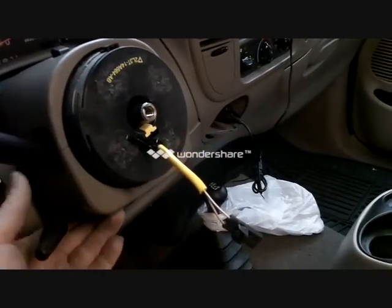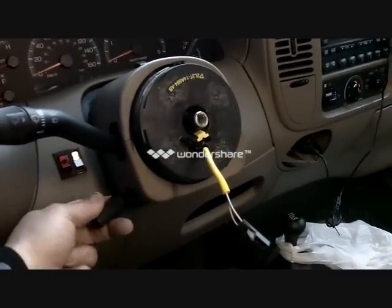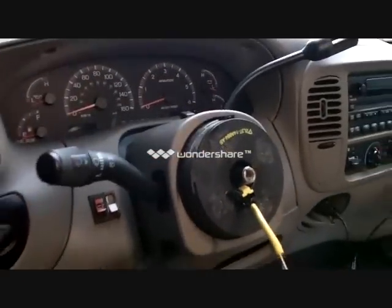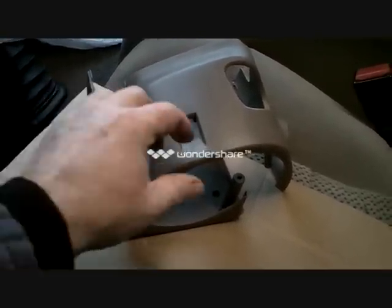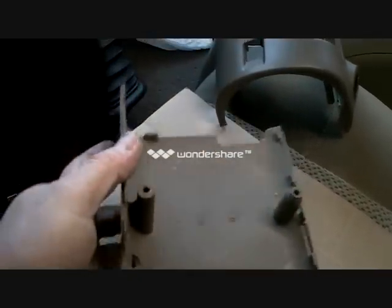Now I've got to take this shield off here — there are a couple of screws on the bottom that have to come off. Now that the steering wheel is off, we want to remove this cover here. You have to use a small wrench to take off the tilt, and then there are two screws on this side and one here to pull off. There are the two halves of the cover — it takes a little finesse to get them off, just a couple of little tabs to separate them, and they come off relatively easy but you have to be patient and work it off.